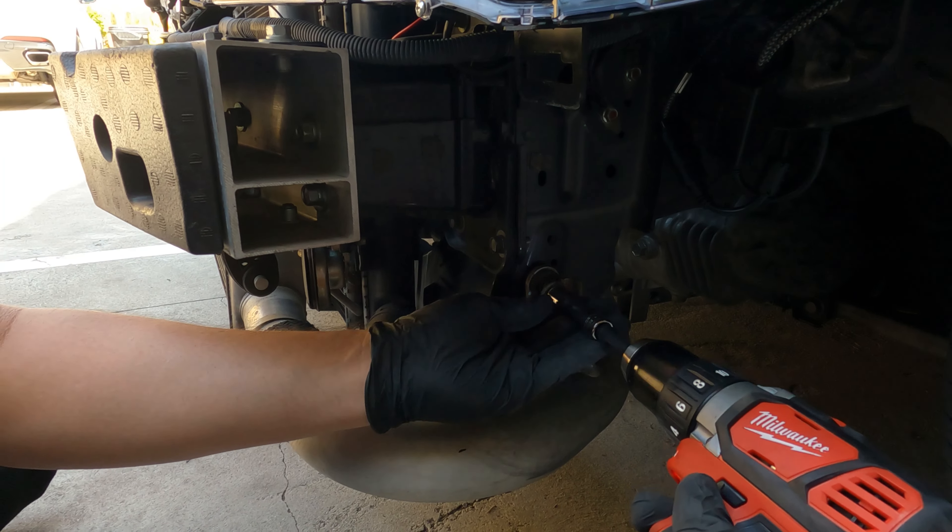I think that's good. Now I'm going to put the upper intercooler piping — I'm going to make it match so it looks right. Put that in first, then put in the little coupler. It went in. If you look right here, this fitment is not working, and the fitment of the intercooler itself — it's hitting against this portion, which is why I took out the front crash bar. This coupler isn't lined up correctly but that's the only way to make this part fit. After I bolted up everything, it's very sturdy. Doesn't seem like it's going to come off. It's a little bit crooked right here.